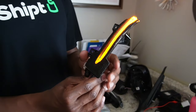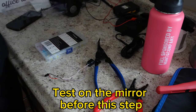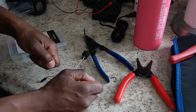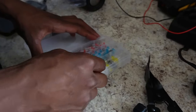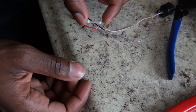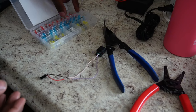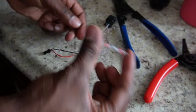I ordered another sub harness so I don't have to take mine out. You can see it cuts on — now that we confirm this connection works, we are going to use these solder sticks. With the old traditional method you use a solder iron or gun and put metal wire and all this extra stuff, but with this it's pretty much just this little thing right here. You slide it in between the wires, then use a heat gun to melt the solder onto it — that's all, without having to use a solder iron or any preparation.